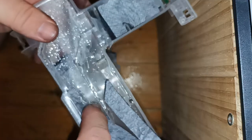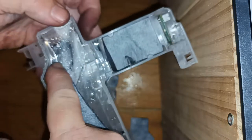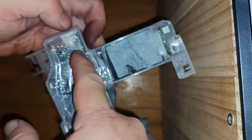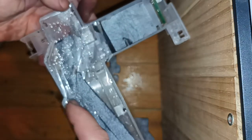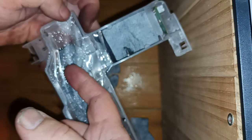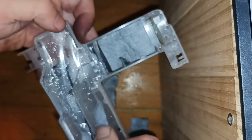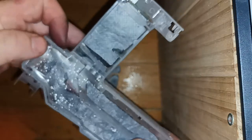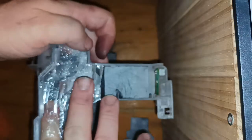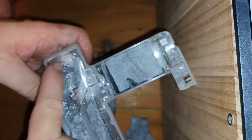Now we don't want to cut all the way along on this plastic cover, because if you cut it any further than here, when the ink comes in, it will simply overflow out over the side here and then all through the printer and damage the printer, which is what we're trying to avoid. And then just get a bit of a pen to push it over all the way to the very end up here. I'll just try a screwdriver.